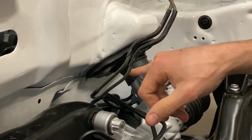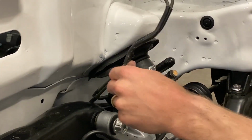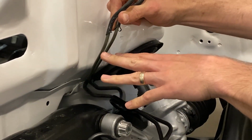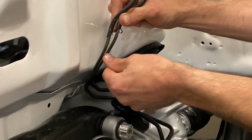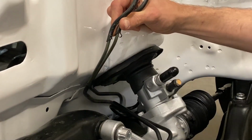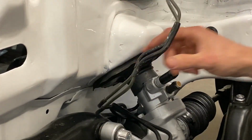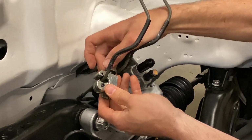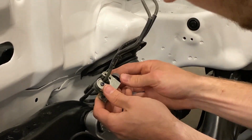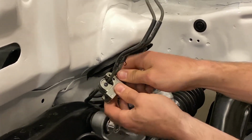So now that we've got the insulation stripped, we can actually go through and cut these. Now, more than likely, these will be cut more than once. But initially, we're gonna cut as much as we can on each section and try and get a nice straight area. Then we're gonna start bending them upwards to install our F-fitting. So like we mentioned earlier, you wanna tighten up the tubing between the rollers, and this is going to bring the cutting wheel up.